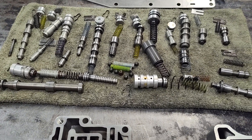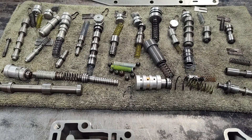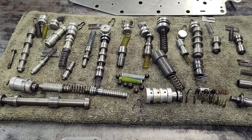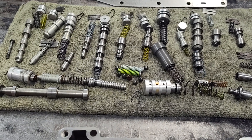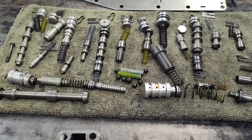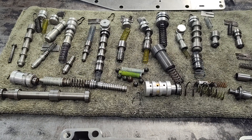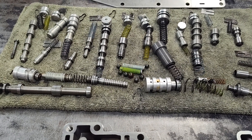I just wanted to show you this apart and kind of tell you a few tips I've learned on it. This is a good unit when you go through this valve body and do a good job on it. Just if you're new to these, I wanted to show you what it looks like. My best advice: do not make the shifts too super hard. There's no real reason for it — it's not really going to save the clutch packs any, it's just going to break things. This is kind of a fragile unit. A unit like a C6 or something of that nature can handle pretty firm shifts, but not this unit. But they don't need to be, and you don't really have all the timing issues you have in some other units too.